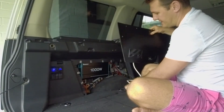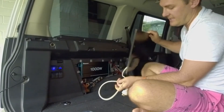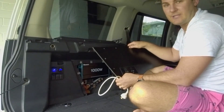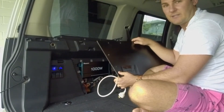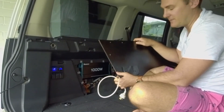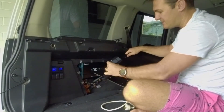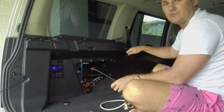Voila, here we are. I've got a 240 volt plug which I got from the local electrical hardware store — hooked up a flexo plug to give myself a double wall plug rather than just a single out of the inverter. It's got its own fuse, so I don't really have to worry about blowing anything up. I'm not going to run anything more than camera gear off these plugs — LED lights at camp run mainly off a 12 volt cigarette plug or an Anderson plug. One thing I want to add is a controller for the Renogy so I can switch it on and off easily rather than reaching behind the panel, and that way it doesn't have that slight draw on the battery.